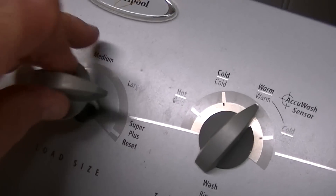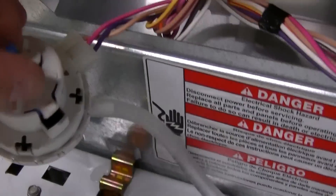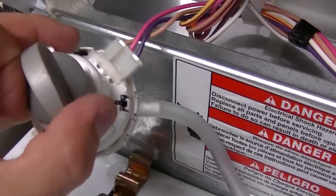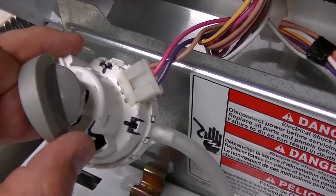What we're going to do is pull the knob off real quick. There's a little lock lever right there — push it in and you can turn it. Leave the hose hooked up and the wires hooked up. Hook the knob back up — as you turn it you can hear it unclick, which means it's going into wash mode.